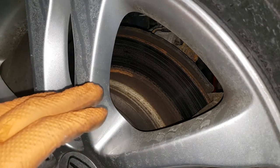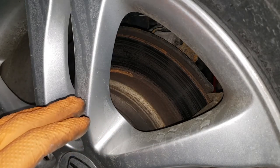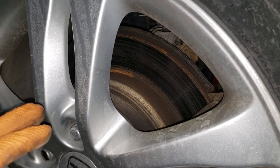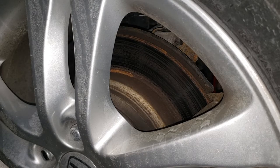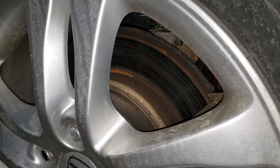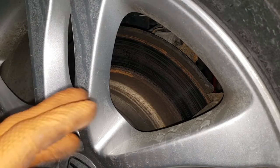This also translates to quite a bumping on the actual pedal. So when the customer is applying the brake, it is forcing her foot back quite a bit anytime she applies the brake. Most times it's more of an annoyance than anything else, but it can be dangerous in a situation where you need your full braking capacity in order to avoid the bumper of somebody else's vehicle. That being said, let's go ahead and fire the wheels off and we'll get this swapped out.